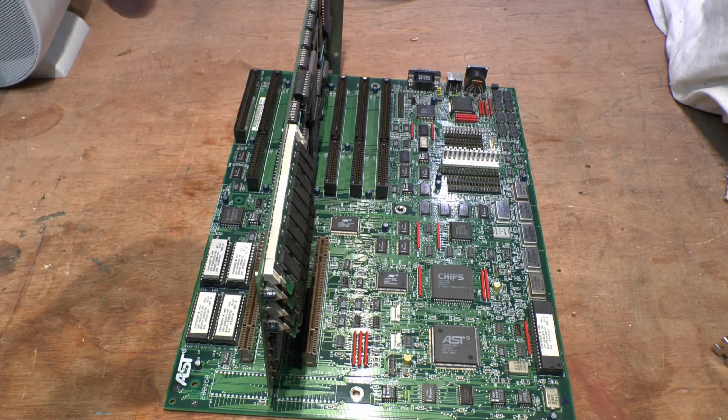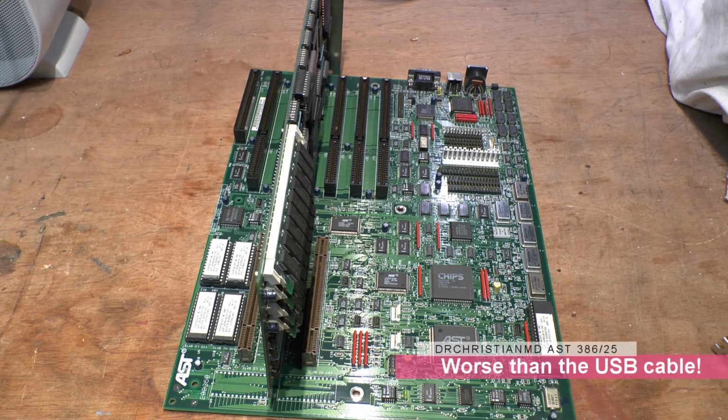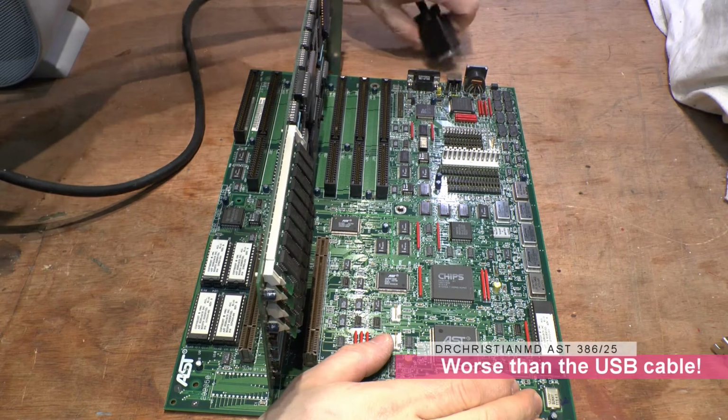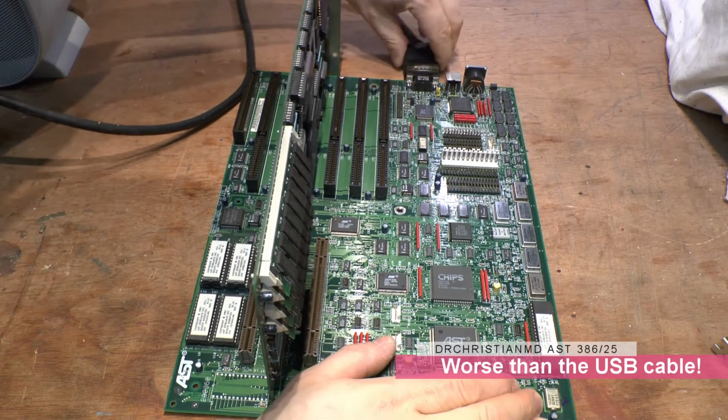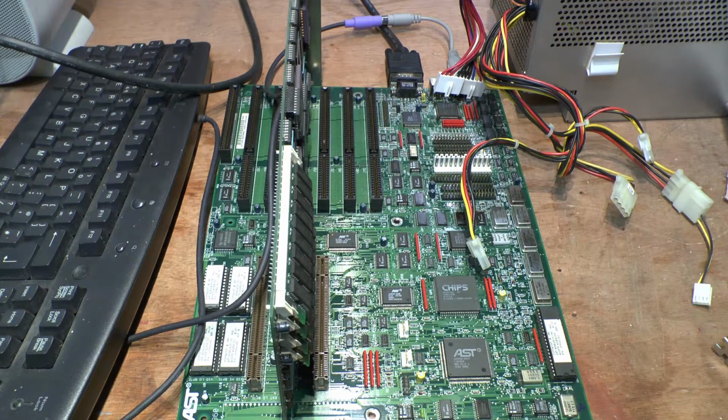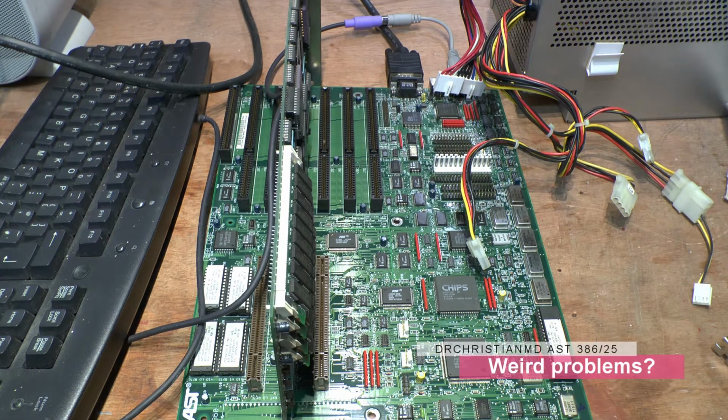The video card is built in, so we can use that. So we can, in theory, just go ahead and plug in a monitor cable, the right way up, of course. Always helps. Something that can cause errors on a computer of any vintage, even a modern machine, is a bad power supply or a dodgy power supply. So it is worth testing the ATX power supplies.